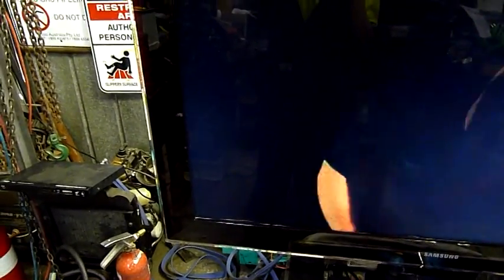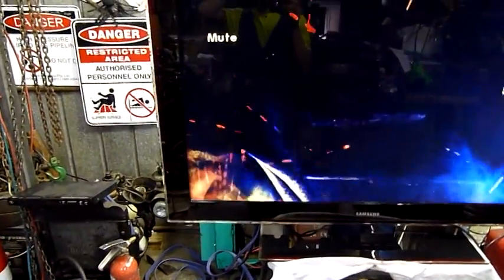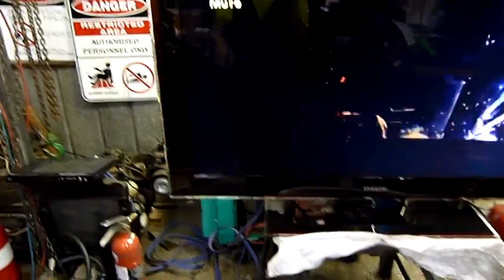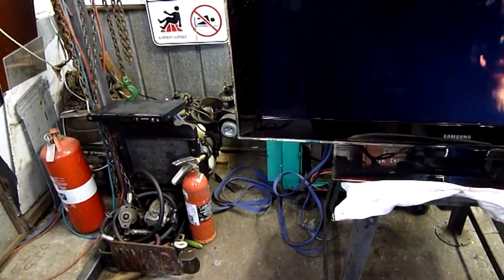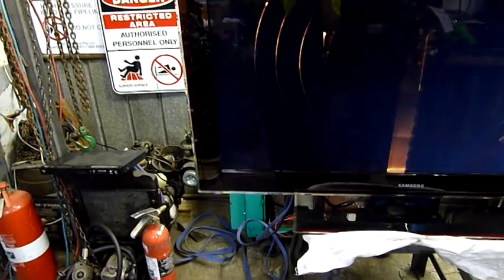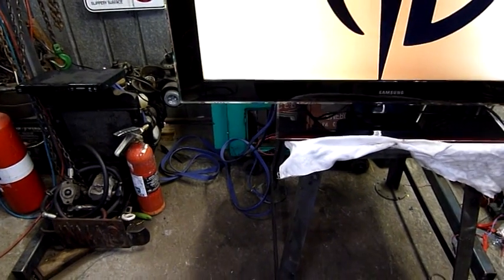Stay tuned for more on this one — it's a nice set. My Hitachi has finally gone blank: still illuminated but doesn't display any picture, so I was hoping to fix this Samsung up and use it, but it looks like we'll be looking at the Hitachi plasma next. The panel still illuminates with full brightness but there's absolutely no picture, probably related to the dithering and multicoloured snow it was doing over the image — particularly on dark scenes. Somebody said it's caps going bad, and it's done a year and a half to two years since then without dying, so who knows. Thanks for watching and stay tuned!